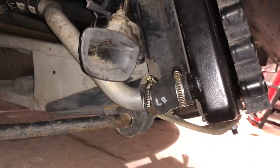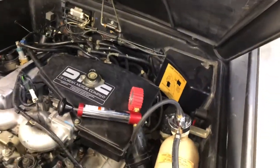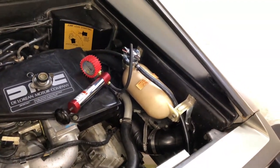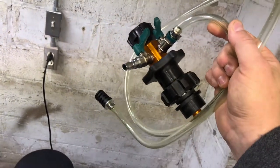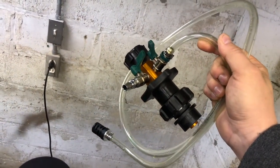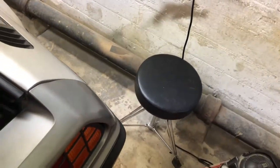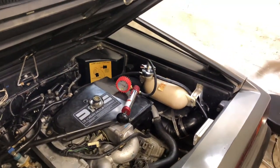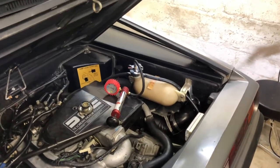This DeLorean has such a large coolant loop that it's susceptible to a lot of air bubbles getting stuck in the system, and apparently this bleeder setup is recommended. I'll leave a link to where you can buy this — I went to a local fitting store and put it together myself. We'll use it to bleed air out of the system. There's the radiator put back together again — I have pressure on it right now and it seems to be holding. The way I filled the coolant back up, using the vacuum coolant tool — I'll leave a link below — I did it about four times trying to get coolant into the system. You put the car on ACC, turn the heat all the way on, lowest fan volume so you can open the heater core, then start filling.